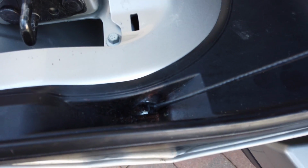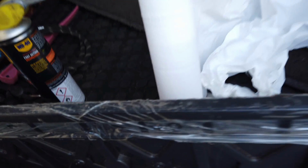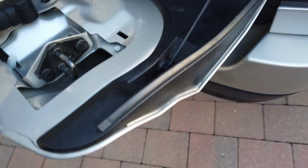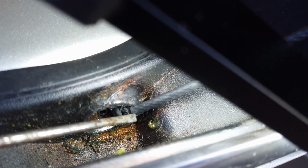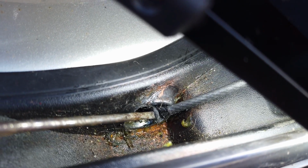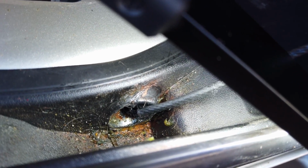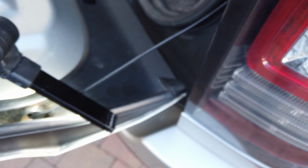I see what's happening. Let me get a wee screwdriver. Let's see if I can position that torch there. So, if you notice, this part here has been stripped of all the plastic. And then it's coming off there, and when you lift that, that bit's catching right on the edge of that part there, see it? And that might be enough to strain the wire, which it is doing. I wonder if I can get that wire out of there and fix that part of it.